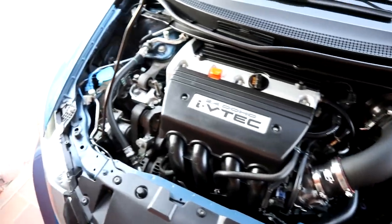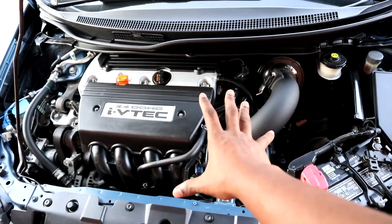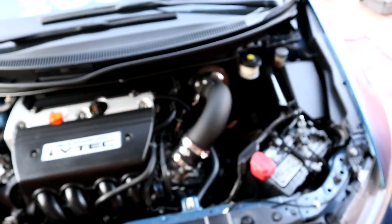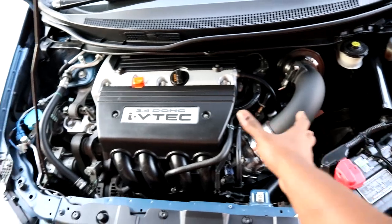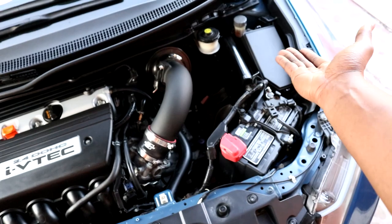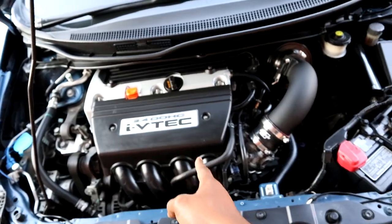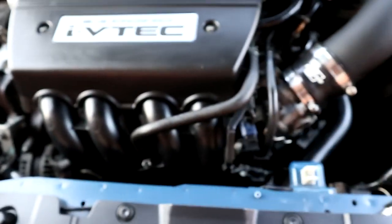After you finish putting the tire shine on, this is how your engine bay should look — nice and brand new. This car has almost 70,000 miles and it's pretty clean. One tip when using tire shine to shine up your plastic parts in the engine bay: use a rag. If you just spray directly on the car it's gonna be real greasy and slippery. With a rag you can smooth it out, rub it in, and maneuver better without overspray. Spray on the rag, then wipe down. Don't soak your plastics or hoses in tire shine because they'll start cracking on you.